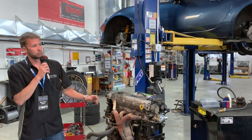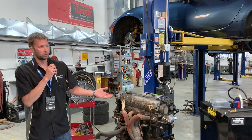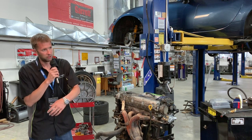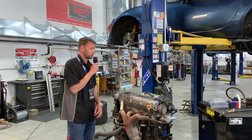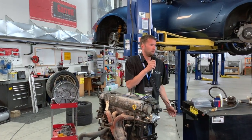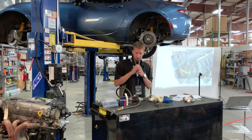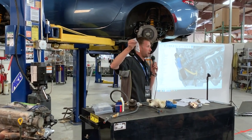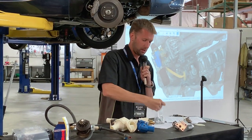Where the turbo water is originally sourced from between the thermostat housing and the water pump, we're including a new length of hose there so that you can replace what you used to have and then route it the new way with a better routing. So short version, you'll have everything you need to put it together. I tore through it this morning, so this is probably a complete hardware kit, but I have to make sure because it was a little bit of a rush this morning.